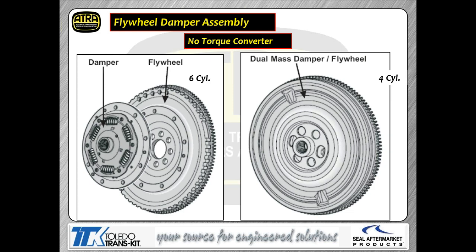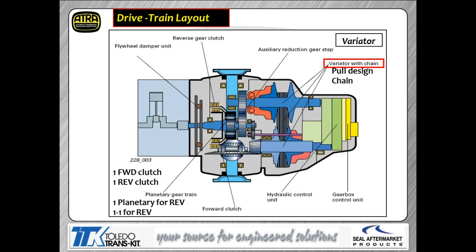There's no clutch to release and no torque converter. When you pull up to a stop sign, it physically slips a clutch. The clutches — visible on screen now — are your reverse clutch and forward clutch. The reverse clutch is the outermost clutch mounted into the case, with the piston in the front housing. The forward clutch sits right inside that. In forward range, the forward clutch operates; in reverse range, the reverse clutch is engaged. The front planetary is controlled by the reverse clutch and turns those gears backwards.